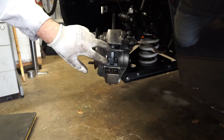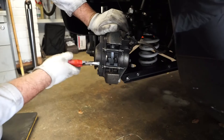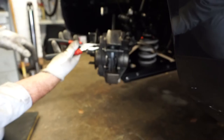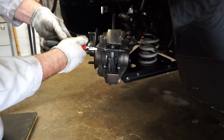You'll be able to see the back of the brake caliper here. What we need to do is draw out these two pins, take the spring clips off — they'll sort of fall off with it — and then we can remove the brake pads. To remove the pins it's fairly easy; it should just be a pair of pliers to lift them up and then draw them out. Some people do reuse these pins, but for this video I'm going to put a brand new set in. It's probably good practice — they are fairly cheap and it's worth ordering around ten at a time to keep in stock.